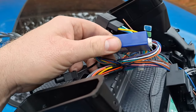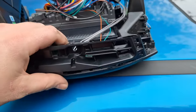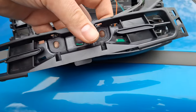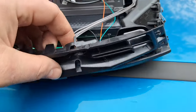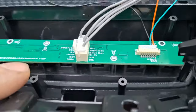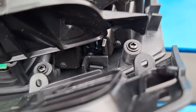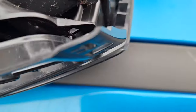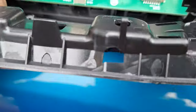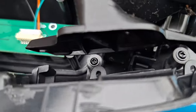Before you put it in the car, remember to get your lower trim bezel on. Find the one that works for your Focus. Being a 2012 model, I'm going to use the one with the two screw holes closer to one another. On the bottom next to the green circuit board, there are little black screws you have to take out to line the bezel up and screw it down. There is also a little clip that pops in to keep everything aligned, and the screws will hold the trim piece down.